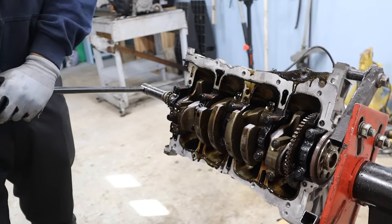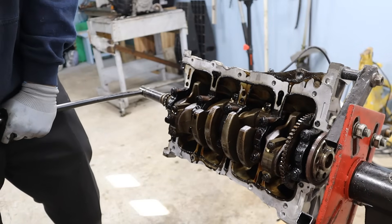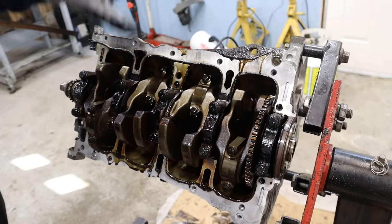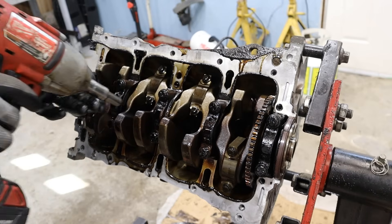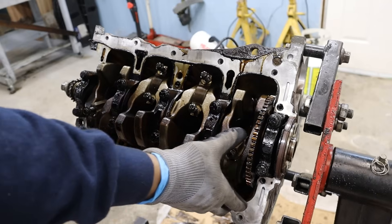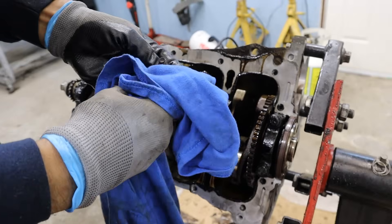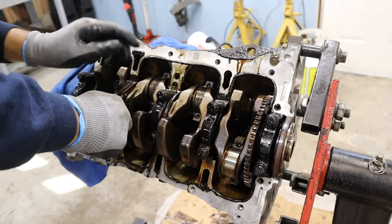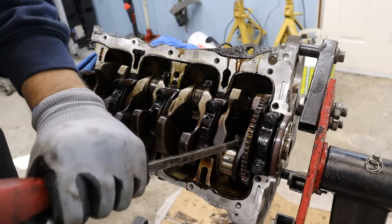We've got oil return galleries over here. We're barely down to the block with the crank and pistons inside, and I still can't get this thing to rotate. I'm going to get all the connecting rod bolts out — we've stripped everything down and this is basically where all these engines fail. We'll remove the connecting rod caps to see what's up — these are 10mm 12-point. Let's remove the last connecting rod and wipe it off so we can see the damage to the bearing. Yeah, that's pretty rough.